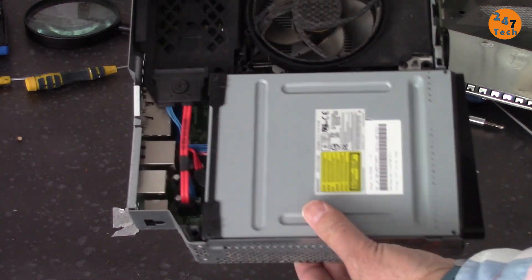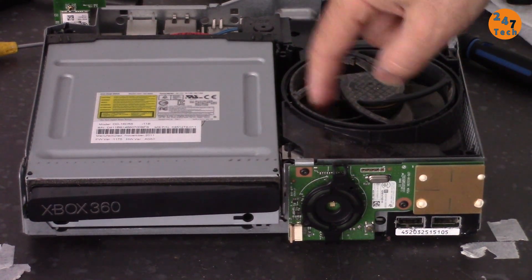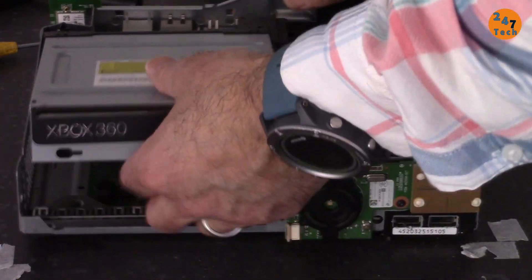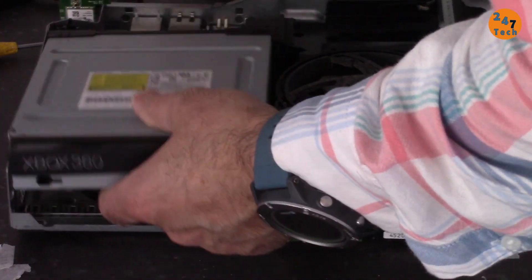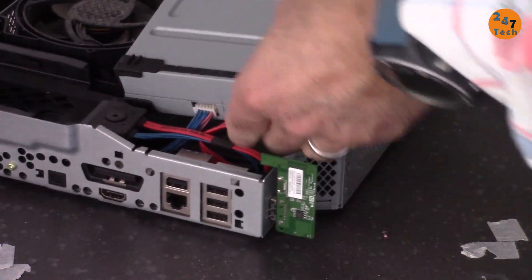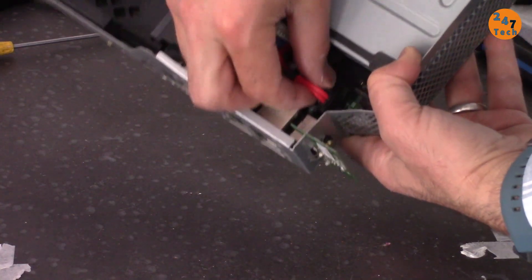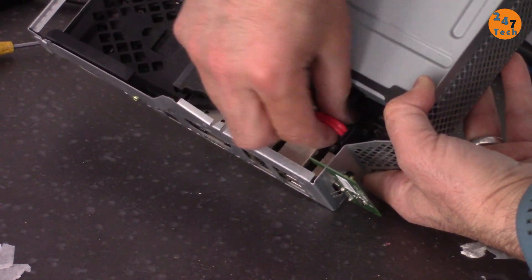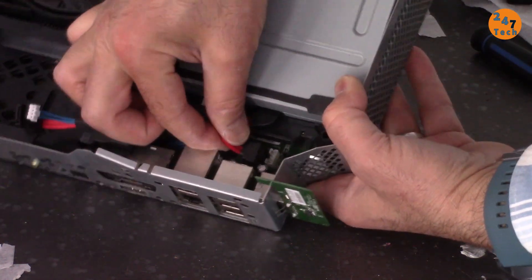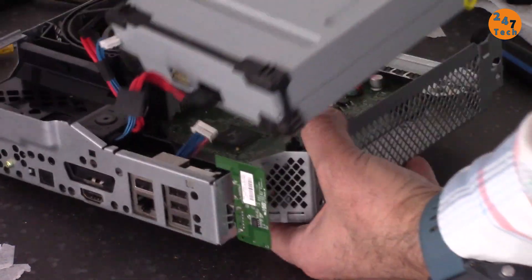Here is what you have access to. I'm going to open this portion and clean up the heat sink, but before that let's remove the CD drive. The CD drive is just loose — it needs the wires to be detached. Remove the hard drive wire first, and after that remove this. And this is out.